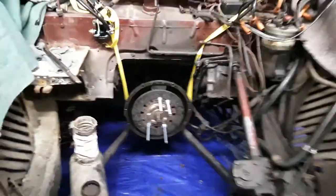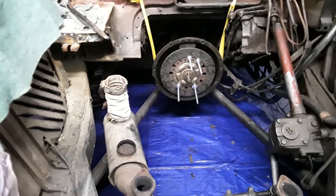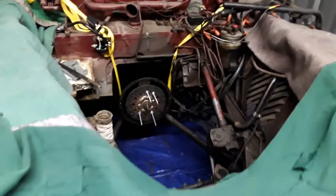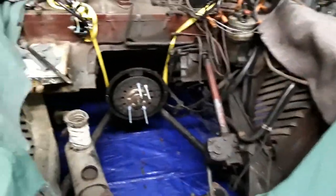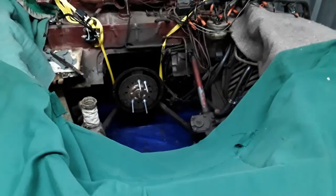The transmission on the other hand definitely has something seriously wrong, and I'm willing to bet it may even be in the overdrive, or in the rear shaft or cluster gear. Something is seriously not right inside it, so I'm going to be hunting down another transmission. That's much easier to do with the engine out — I don't have to pull the rear end out to get the transmission out now. For a clutch or transmission job in one of these cars, I'd actually recommend pulling the engine rather than the transmission, because it's less work.